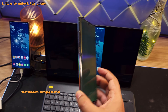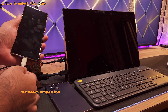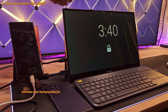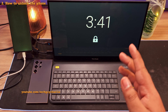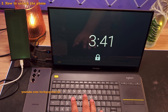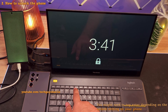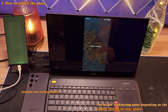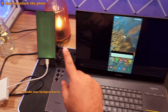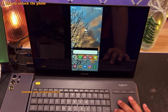For those who are curious, the phone with the broken screen is the Note 10 Plus. Upon plugging the Note 10 Plus into the adapter, once again we get a screen with a lock icon. The unlock procedure is identical: make sure that the phone is awake, tap on the spacebar to bring up the lock screen, and then type in your unlock pin. And there you go — see how easy it is to unlock the phone with a completely non-functional screen. Even though the touchscreen isn't working, we can now control the phone through the keyboard and the mouse.